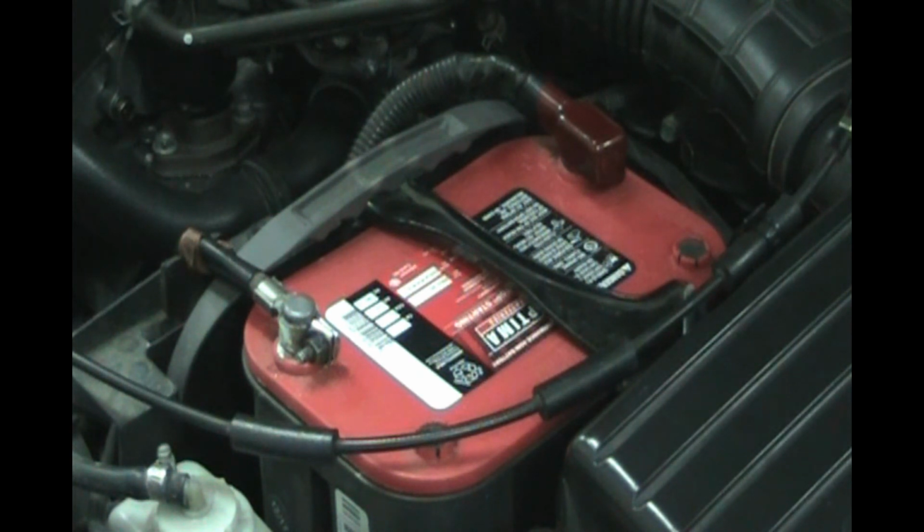The more modern cars, the more electronics. This car, you don't have to re-index the windows. Newer cars, it's a safety feature for children so that the windows don't go up and pinch their fingers. You have to set the windows, and you can look in your owner's manual to see how that's done. Some of the cars you just go down halfway and then raise the window up and hold the window switch up for like 10 seconds, and then it knows the window is closed. That's how it indexes. You have to do that on all the windows.